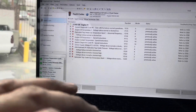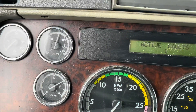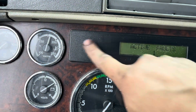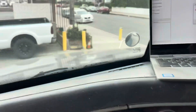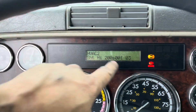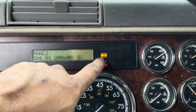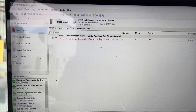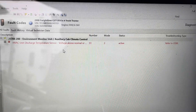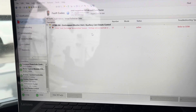That's it, guys. If you like the video, give it a thumbs up. After cycling the key: check engine light is gone, stop engine light is gone, malfunction light is gone. The HVAC light will still stay because that's a separate issue. The ABS will pop up once you run the truck over 5–10 mph and will go away, provided you don't have any actual ABS codes — the Detroit software triggers it and then it clears. The HVAC code is 'unit discharge temp sensor voltage above normal' — possibly a sensor itself, but that's outside of what I do today. Thanks for watching!